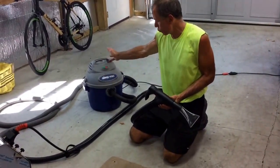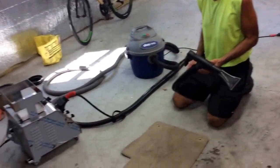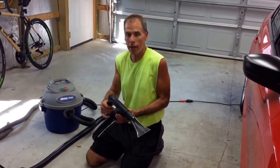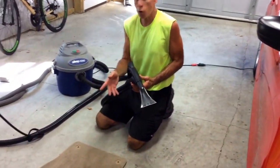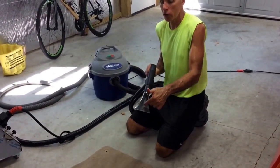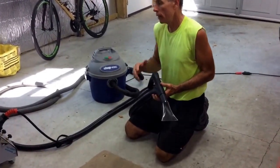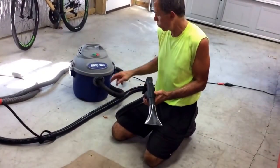What we need to do now is turn our vacuum on. The hose is long enough — you just connect the two together. We turn the vacuum on, we already have steam ready to go, and we already have injection ready to go. So we're going to start off with steam, and then as I feel I need injection, I'll activate that. You're going to see the water get sucked up through the suction tool, demonstrating how wet things can get with the 125 machine.